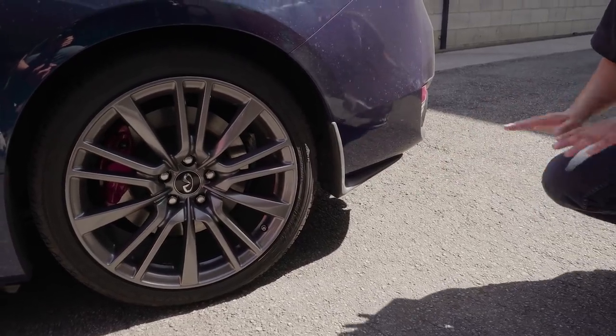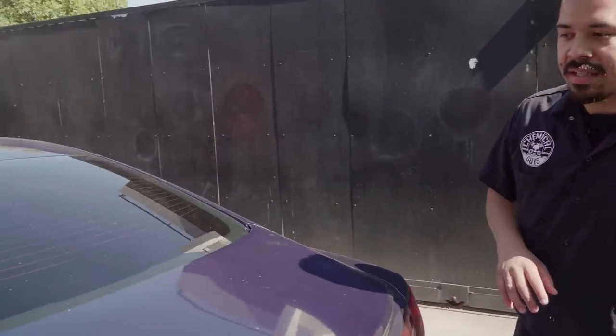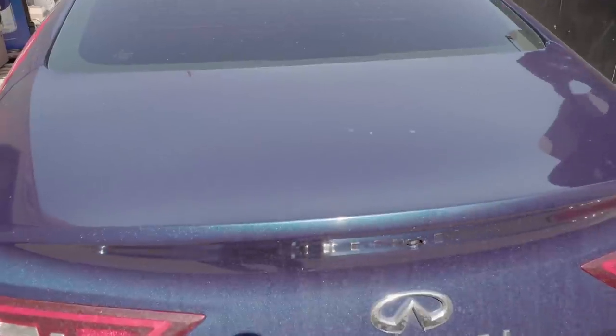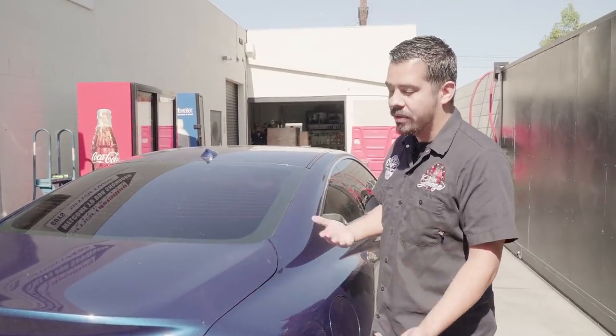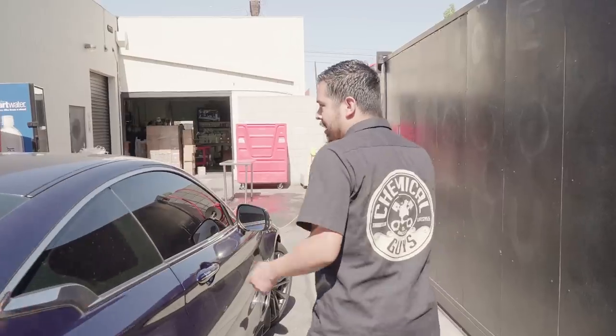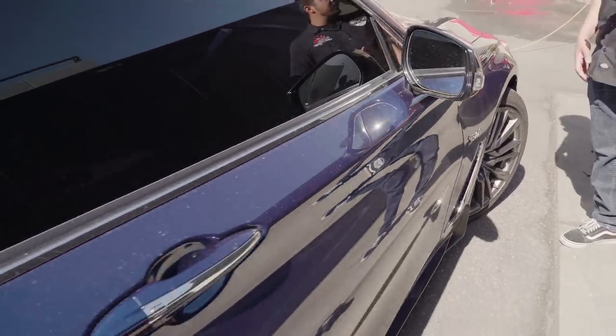That's a big no-no whenever you're applying wax — you want to make sure you don't get it on the plastic. But for the main focus, we want to worry about the paint. If you come join me back on the trunk, there's a ton of scratches and swirls. This car is a 2016, so it is on the newer side, but there is still some neglect between those four years. There's a lot of industrial fallout and a lot of embedded contamination on the paint. Walking around the vehicle, you can see little dings, little scratches, fine swirls, and a big chunk of bird dropping right here. It's best to always inspect the paint so that you know what you're working with.